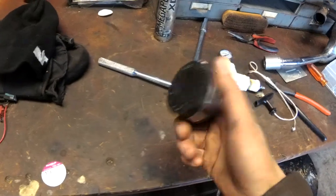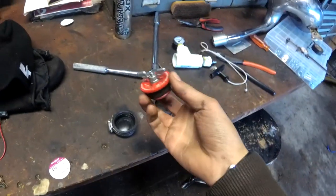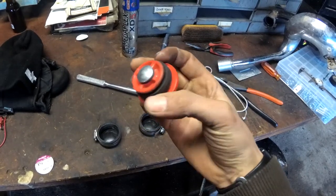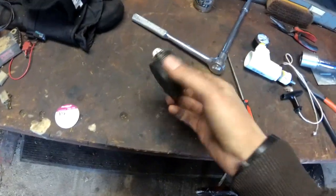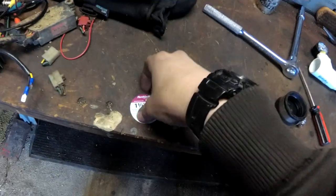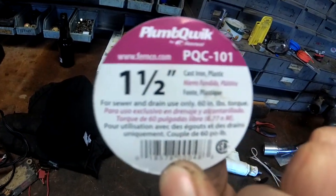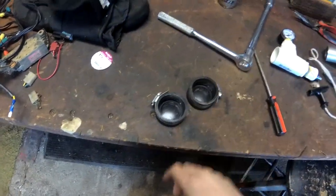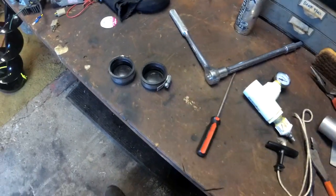What I did — I got these. There are a few different styles of plugs you can use. For a Banshee you're going to need two for your exhaust, to plug the exhaust. You can use one of these expandable ones — this one is too big to go into the exhaust though. I'd rather use one of these test plugs. It's basically a one-and-a-half-inch test plug. They're a little big for the exhaust ports, but I think I might just wrap some electrical tape around there and that'll be fine.